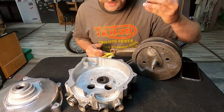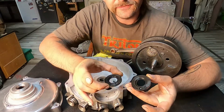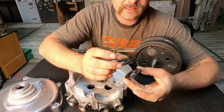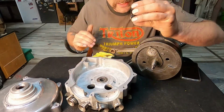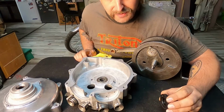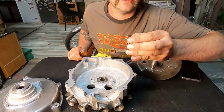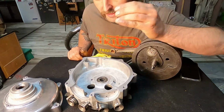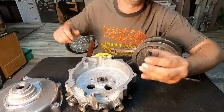So here we are. Now I used OLC 45 and they treat it at quite high temperature, so it might be that they are a little bit deformed. I will check that on the sandpaper on a planed surface, and also after they are planed I have to mount again and see how much I have to take out again.